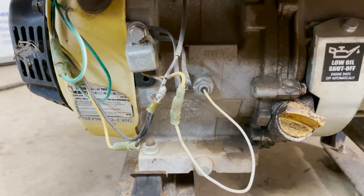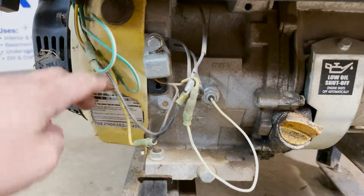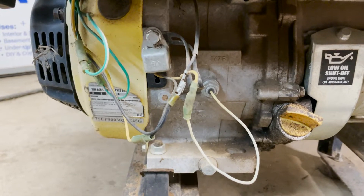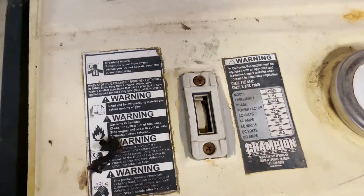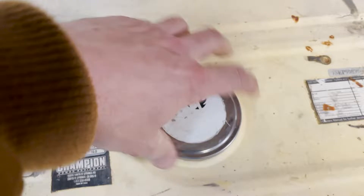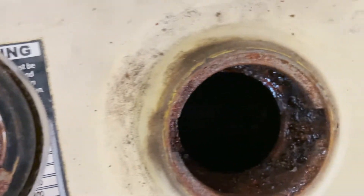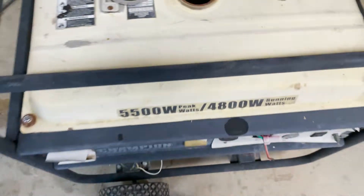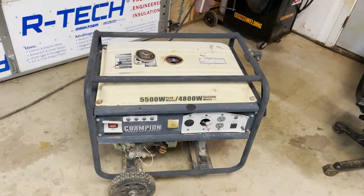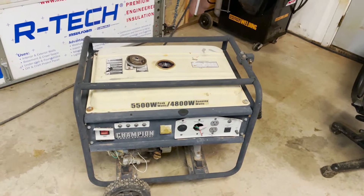The carburetor I ordered for it says it's good for a GX390. I wish some more of these stickers were still here, but I can't really get too much off of it. As for the fuel tank, there's nothing in there, so that's just been able to get water in there. I don't think I want to see what's in that black hole. I'm going to go ahead and just yank the gas tank — I'm switching this thing over to propane, we don't need gas. In the future I've already found a replacement fuel tank for it — it's 60 bucks, a seven-gallon fuel tank that looks like it's the right one.